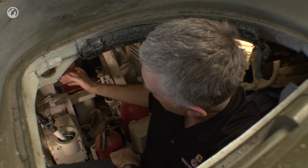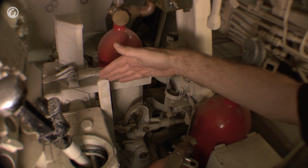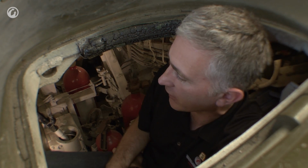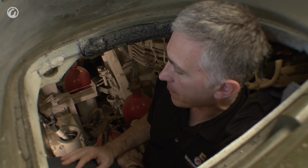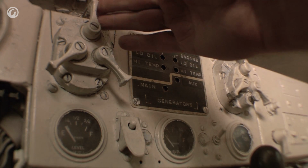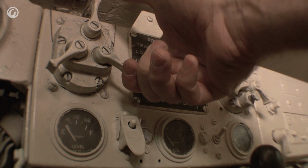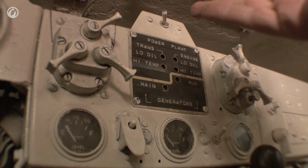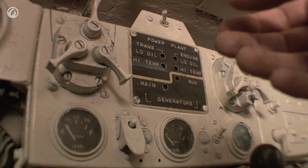Further forward and down is a large lever for the parking brake. It's basically you depress with your foot the service brake all the way, then it's a simple latch. It just locks the pedal in place. Forward of that, he has his instrument cluster. Speedometer, tachometer, light switch. It's easy enough to go to blackout markers, but in order to go to one of the service drives, you have to release a safety lock before you can move it on to a full headlight. And this just stops you accidentally illuminating yourself and the world in the middle of a battle.